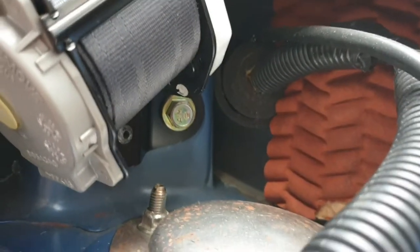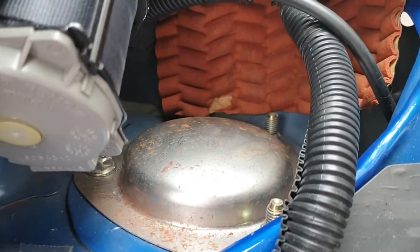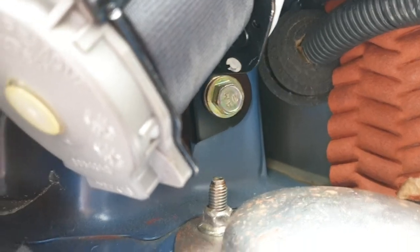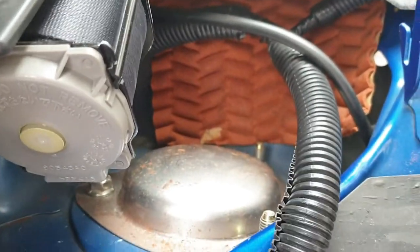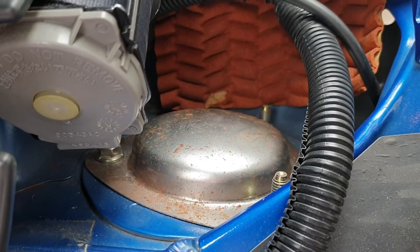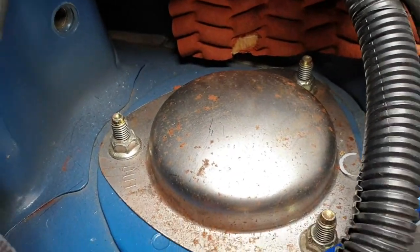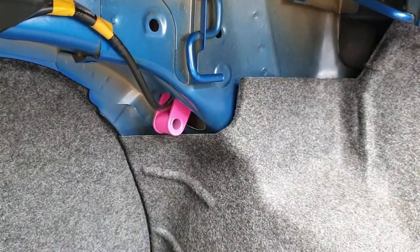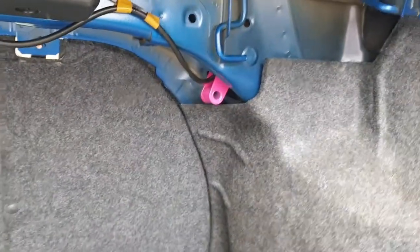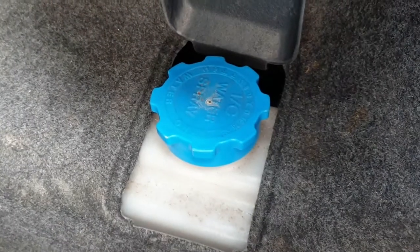It's not all 12mm here — I cannot get through with this piece here. It's basically impossible to do anything about this specific bolt without removing this piece. It's actually a 14mm and I'm trying to get that off quite carefully. We're talking about a seat belt, so you've got to be very careful. After it's removed it certainly makes a difference — helps you reach it better. Now you can see it coming off. We have to be careful with this hose I told you about — it goes through all the way to the container where it throws ice water on the intercooler.